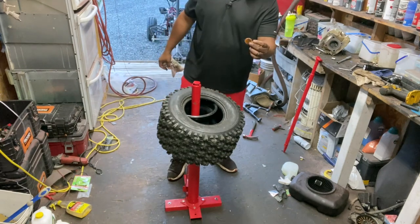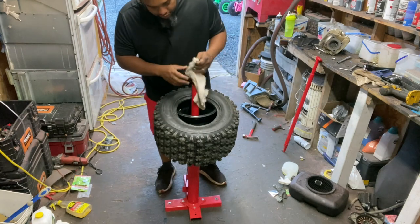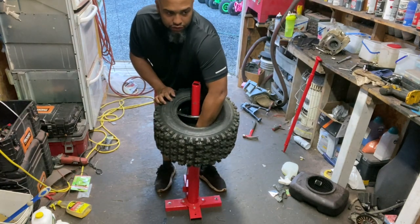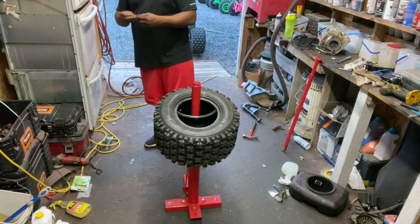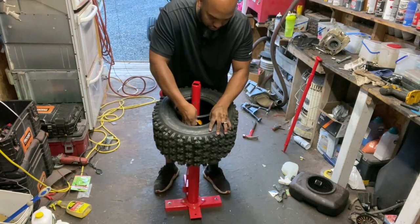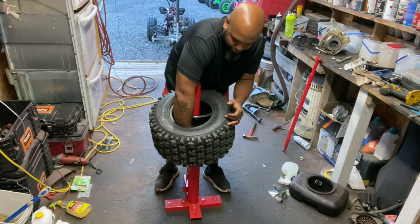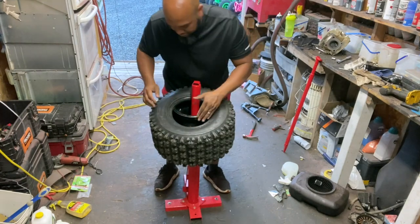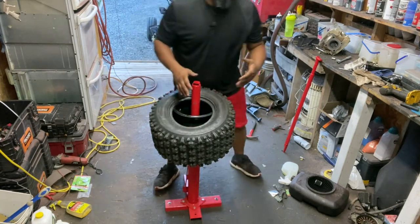So our patch was down in there and it did come off, so I'm just going to put another one right on here. The reason being is that even though the tube is going to be in there, I want to give a little extra sidewall protection. So I'm going to put that patch right on the hole. It's right on top of the hole right now. What's going to happen is it's just going to sit there and let it dry.